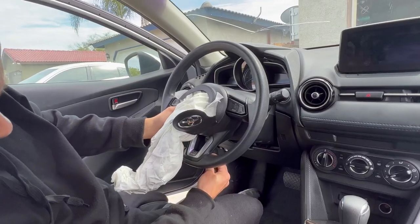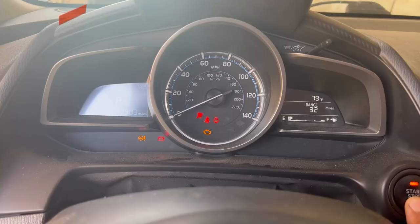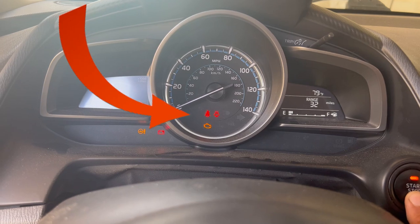We finally got the airbag module right here. It took me a long time to find the location on this car. I'm going to walk you through the whole process of how I was able to get it out. The reason I took it out is because after the car accident, the steering wheel airbag got deployed. I replaced it with a new one and still, even with the OBD2, it won't clear. This module stores everything — if the car's been in an accident, it's already stored in here. So I sent it to a company which took care of resetting the crash data to make it brand new again.